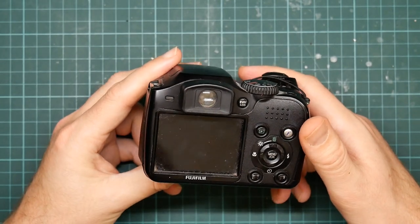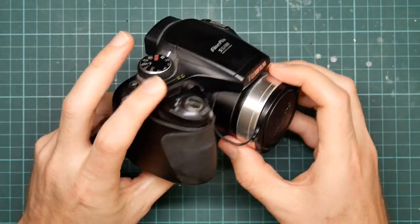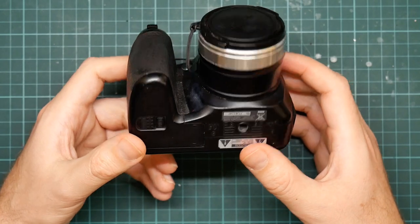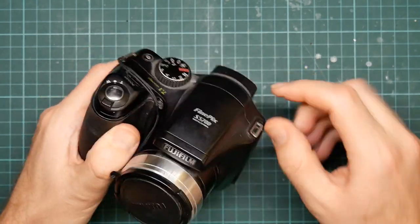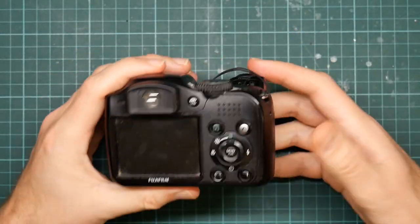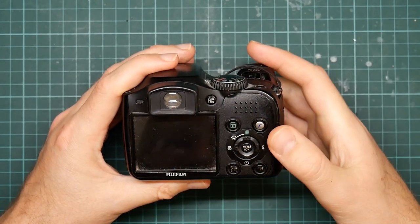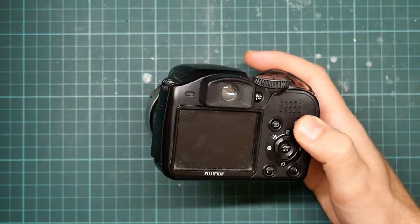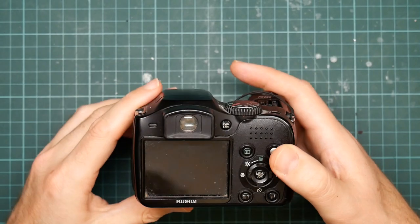This is a little bit risky in two ways. Firstly, digital cameras are pretty delicate. And there's a reason why I want to do this with this old camera, because this is worth nothing. I actually thought it was broken until I tried it earlier. The second risky part is that the camera flash is driven off a pretty meaty capacitor. And it's important not to let the capacitor discharge through me, because this can be potentially life-threatening. So I am going to have to be extremely careful and possibly make sure it's discharged using my patent discharge resistor, which is not patented.